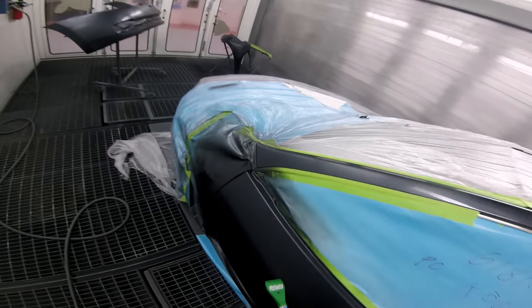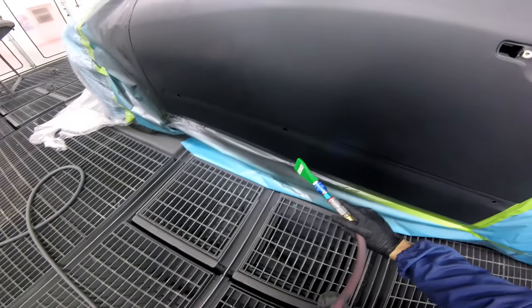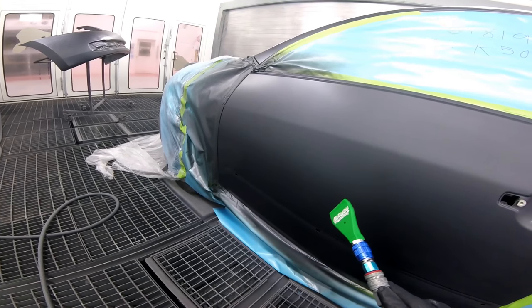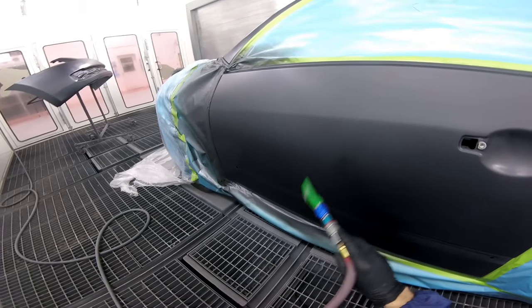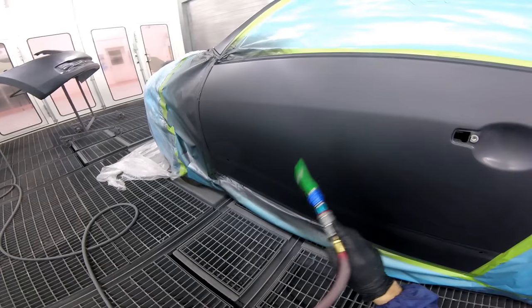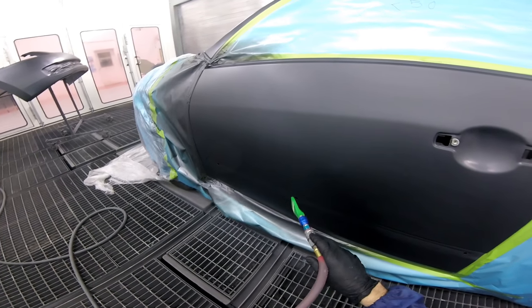I tack in between coats because I want to prevent overspray and make sure I don't have any sand piling. I do it flat because I need to get all that base overspray out of there — I don't want it underneath my clear coat. If you've ever had little bumps under your clear that look like dirt but are tiny, uniform, and even, that is the base underneath just poking its head out. That's why I tack.